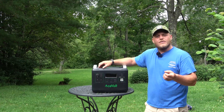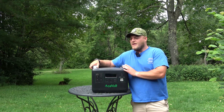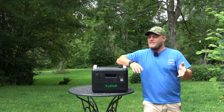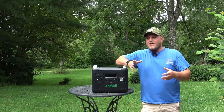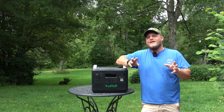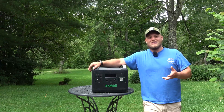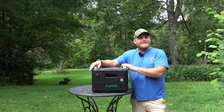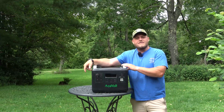The last thing I'll note is I'd like some adjustments on that charger. If you've worked with batteries — whether lead acid, lithium NMC, lithium iron phosphate — you understand that charge rate really affects how you degrade them. 1,100 watts is awesome and impressive, but if I want to set this on the charger all night, I'd like to be able to turn that down. That would be a really nice feature. I see some companies starting to do that.